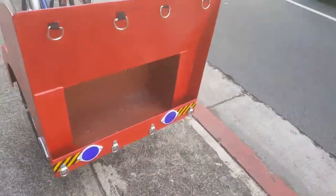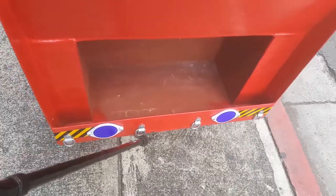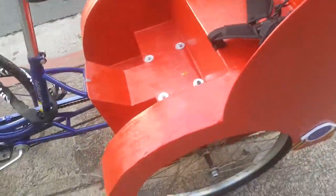It's done. I got the seat belt on there, a safety flag, some safety features, and hooks to tie stuff with. I did have one major problem: because I made the drop five inches it barely misses that frame part right there, which causes too much weight to go to the back side, so I had to add a little board to keep the weight off of it.